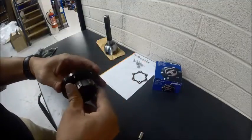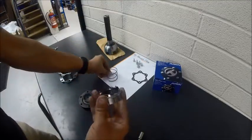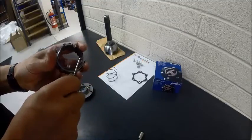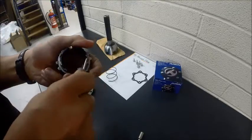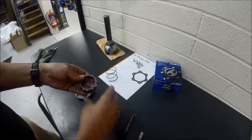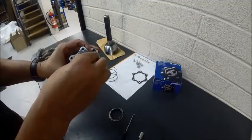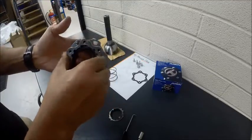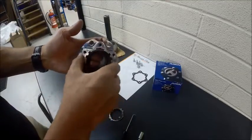I'm going to pull this whole hub apart and show you the components inside. This is one of those things — it's not that difficult, but it's very tricky if you've never seen inside a hub or if yours has pulled apart. Quite often what you'll find is these two have become disjointed. This hub ends up inside the main hub giving a permanent drive. Even though you engage free, there's nothing to pull that hub away, and that's why you've got permanent drive.